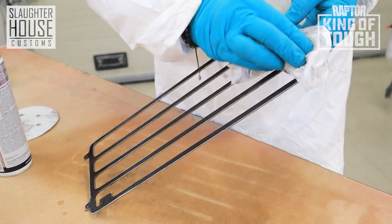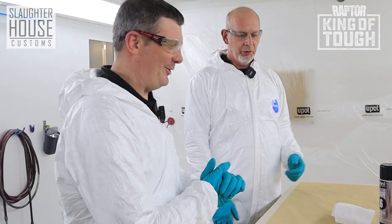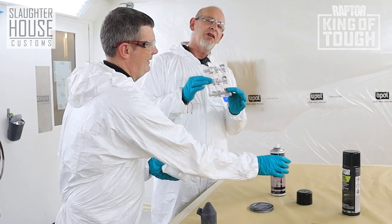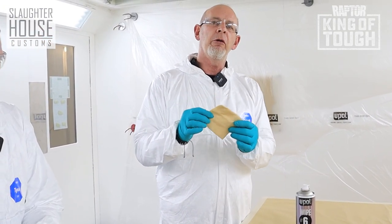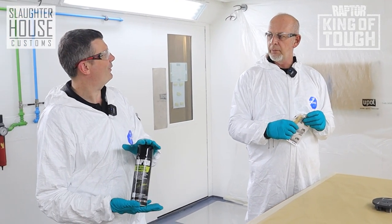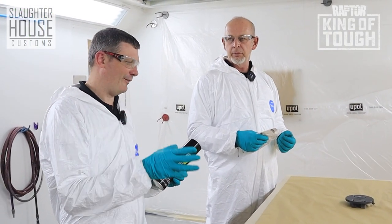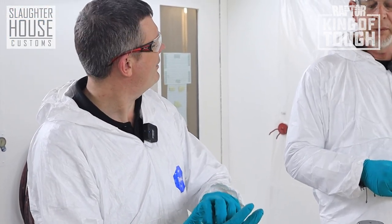First let's spray up these plastic bits and bobs. We're going to wipe them down again, just to be sure, ready for the application of the adhesion promoter because this is plastic. We're going to tack them down as well. This is a tack cloth — it's designed to remove any fragments or dust from what you're about to paint. It needs applying correctly. If you over-apply this product and put it on too heavy, it will actually create a film on the plastic and create a barrier so the Raptor can't stick. Two light coats, 10 minutes flash off. This product works over time — it conditions the plastic, softens the plastic, giving the coating you're putting on top a chance to chemically bite or chemically adhere to.